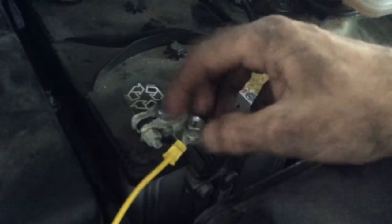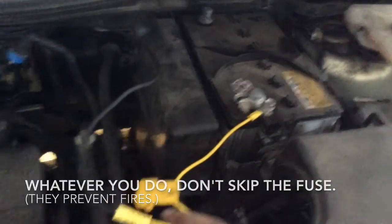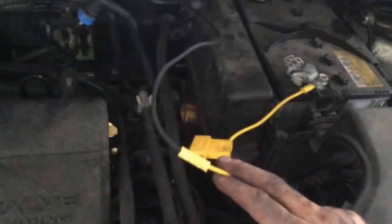Alright, so after disconnecting the negative terminal carefully, so as to not strike the positive terminal, I undid this little contact here and fitted on the new piece, already done the splice. I'm just going to dress out the balance of the wiring in the engine compartment here as I get it tightened down and figure out how I want to run it underneath the battery cover, and that'll be the end of the wiring, and then I'll get into testing.